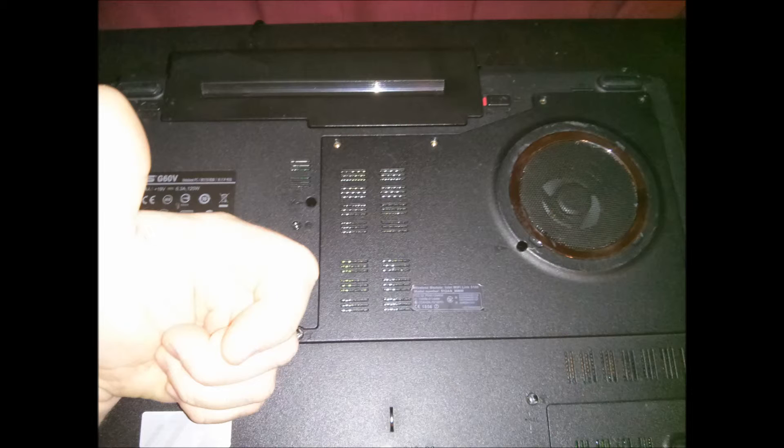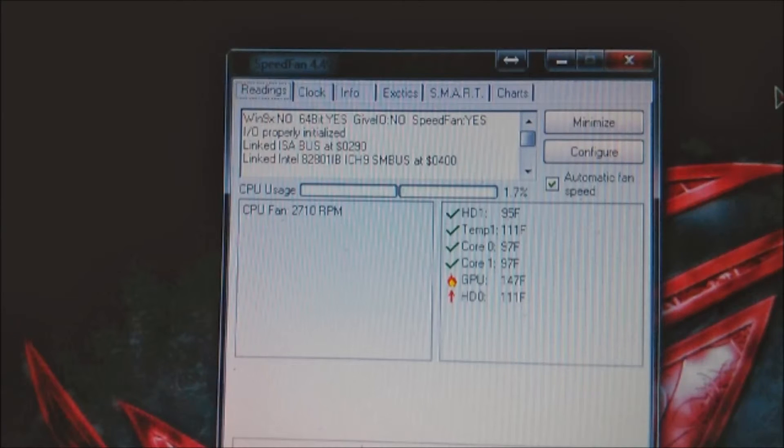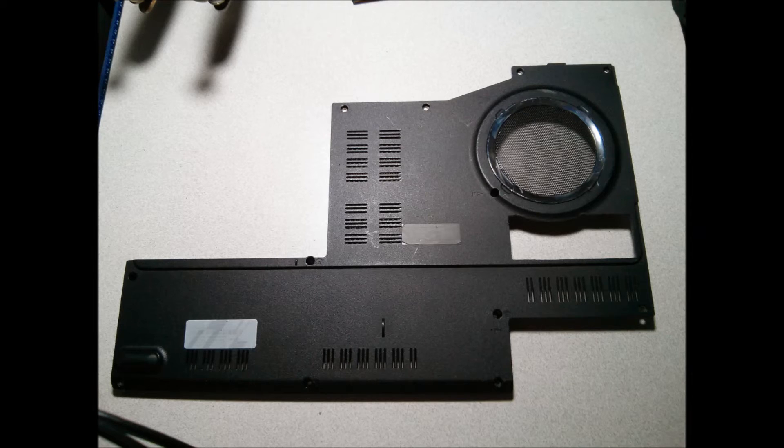Before this phase of my mods, I had consistent GPU temperatures over 200 degrees Fahrenheit, which is untenable. I found the proper Nvidia video graphics driver — I think it's 186.62 — and after that I was able to get RivaTuner to work with it. I got the temperature down even lower than this screenshot shows, averaging around 134 degrees Fahrenheit at idle or under consistent loads.